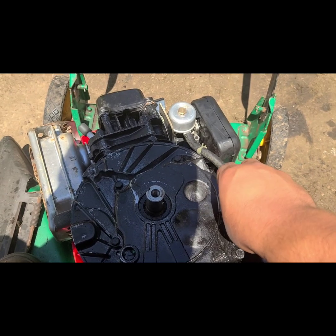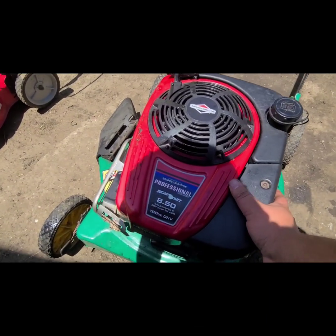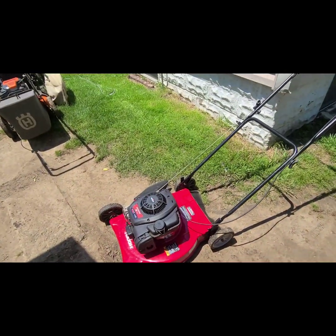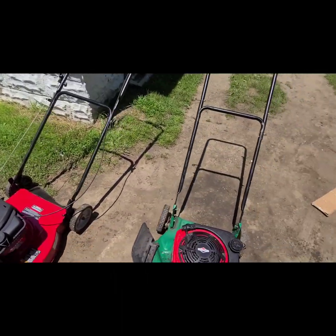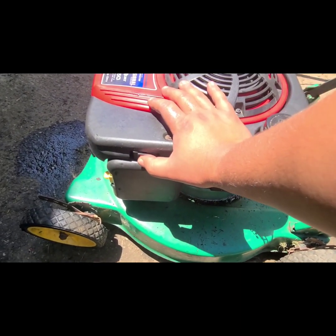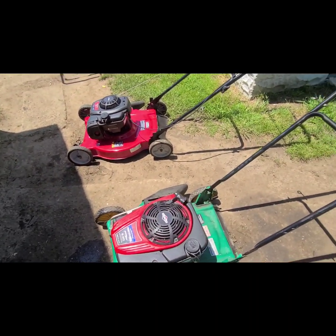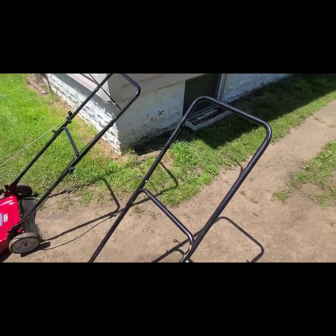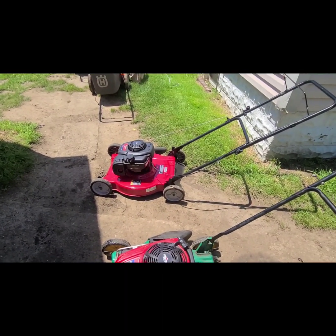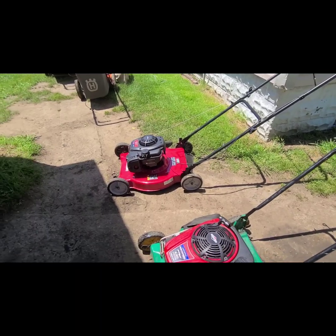There are some details I'm going to go over with this motor before we mount it. This particular Briggs eight and a half horse engine does not have a bail brake, unlike a typical push mower that has a bail brake. Instead, since Briggs and Stratton didn't intend this for use as a push mower engine, they put an on/off switch above the carburetor wired into the coil. If you know what you're doing, you could wire a switch up to the handle from the coil for added safety. I'm not going to do that because this is a personal mower. I encourage you not to build these if you don't know what you're doing, but if you do, go ahead at your own risk.